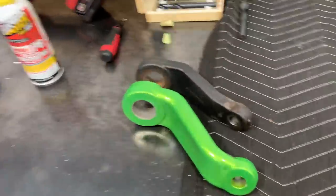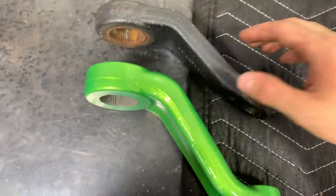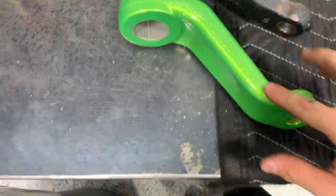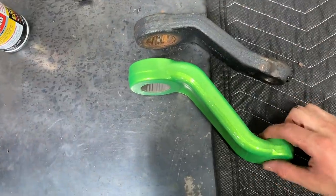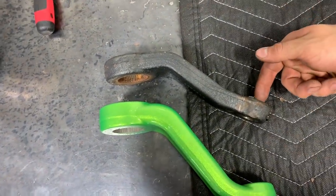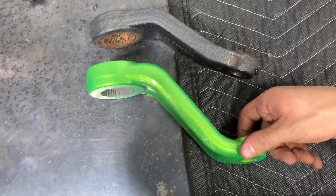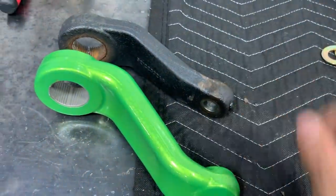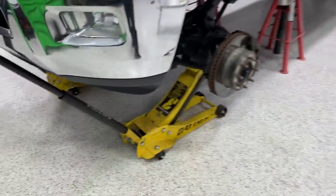The next step is the pitman arm. The reason they do this is because the drag link — everything gets dropped down. Pretty much every aftermarket pitman arm for a lift after a certain height has a longer neck, which gives you more angle down to drop things lower. Normally the drag link bolts in from the top, but to get that shaft even lower they now bolt on the bottom — the taper is basically just the reverse. This goes on with thread locker at 220 foot-pounds onto the steering box shaft.